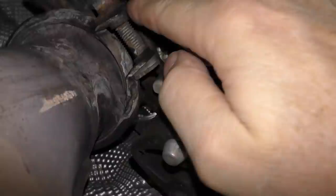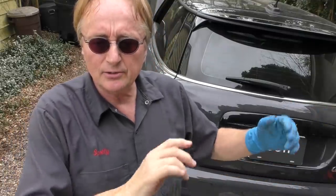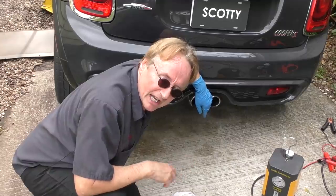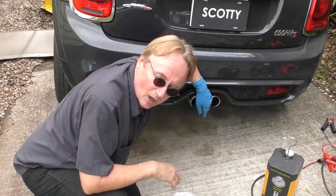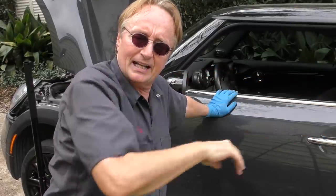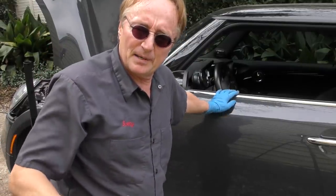And here is a real big tip — it's wet here. You might think, what the heck does it mean that it's wet there? Well, that means that's definitely where the leak is. When you burn gasoline, which is hydrogen and carbon, in the earth's atmosphere using nitrogen, oxygen, and trace elements, one of the byproducts is water. Check out your car some morning — start it up and you'll see water dripping out of the back of the exhaust. So the fact that this connector has water on it means that water isn't making it all the way out the tailpipe — it's coming out right there. And there's a clamp there. This thing is notorious for vibrations, and the clamp is just loose.